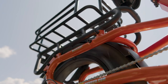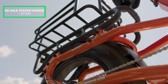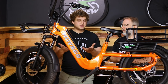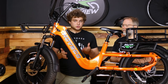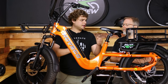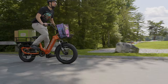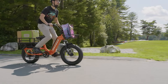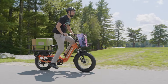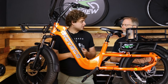The range on this bike with a 720 watt-hour, 15 amp-hour battery is claimed at 60 miles. I'm guessing that's with plenty of your own pedaling — more like 40 miles if you're doing heavy acceleration and heavy throttle. The reason they're able to get this range is because of the torque sensing. A lot of e-bikes have cadence sensors, which just detect whether you're pedaling and throttle up to some speed. You get a lot of ghost pedaling where your feet are moving but putting no work into the drivetrain. With torque sensing, that almost never happens — the pedaling you do is multiplied by the motor.